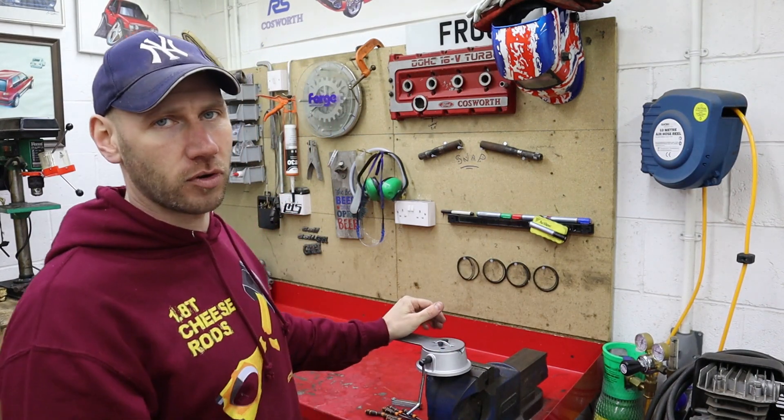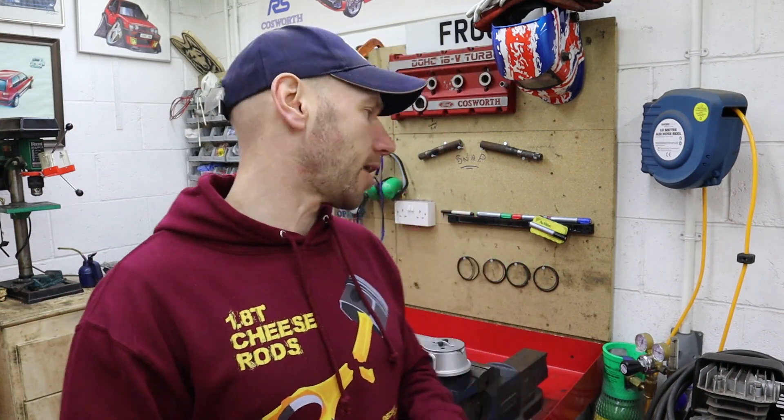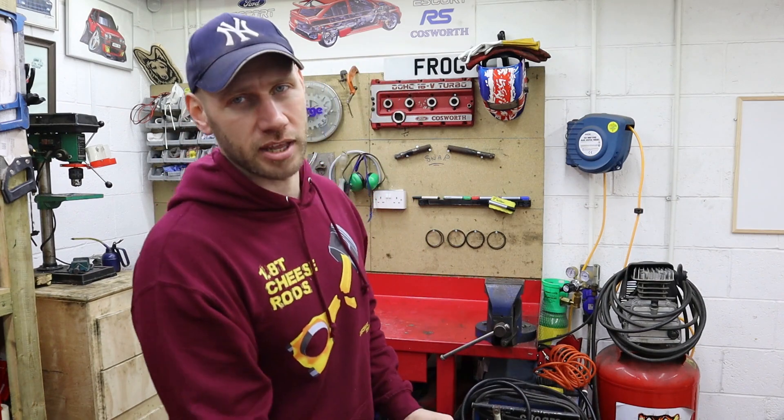As it goes, the oil control rings are all mint from factory, all at 0.4, so I'm really happy with that. And that's the ring gaps all sorted - they're all on the board ready to go. I just need to get the pistons and rods assembled, then get the rings onto them and get them in the engine. It's starting to come together. Next video we'll put the crank in and check all the clearances, then we'll get the pistons, rods, and rings together. Subscribe if you want - big thanks out to Stacey Fenton, really do appreciate it mate. Go check out Pro Race Engineering. Thanks for watching, we'll see you on the next one.